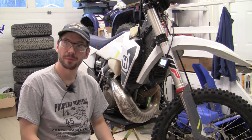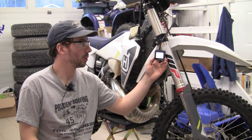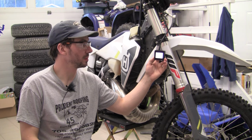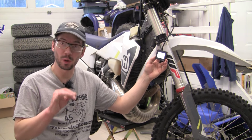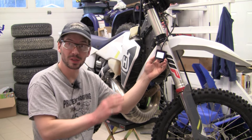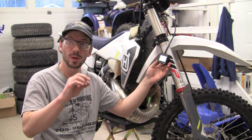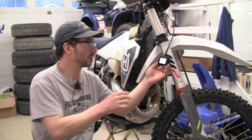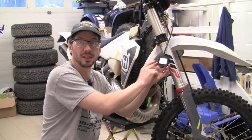All right, here we go. I've plugged the TSP ERM module in. It has turned on and I swiped over to the one screen. It tells me my throttle position is at 12.5%. A default stock should be between 12.5% and 13.9%, so I'll start here at 12.5%. I'll get the bike started and see how the revs are making out, and then tweak the throttle to get that nice idle of 1450, which I can see from here on the ERM screen.